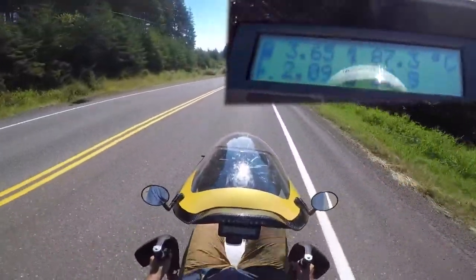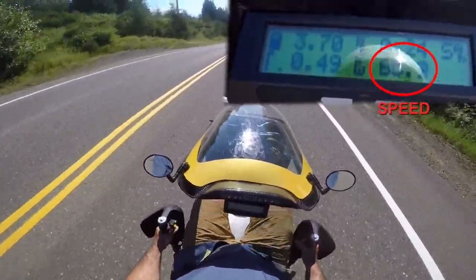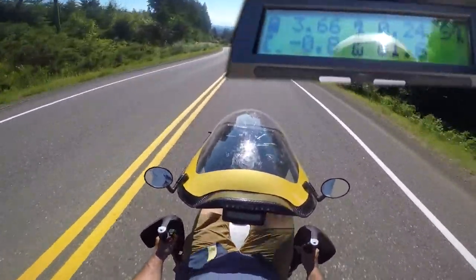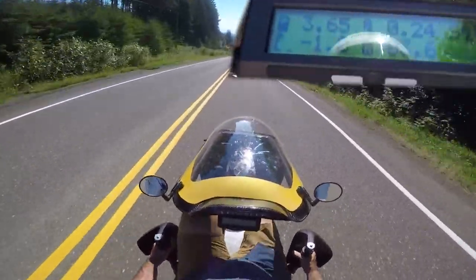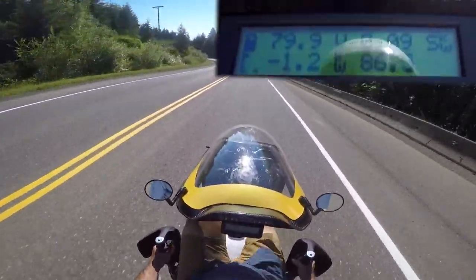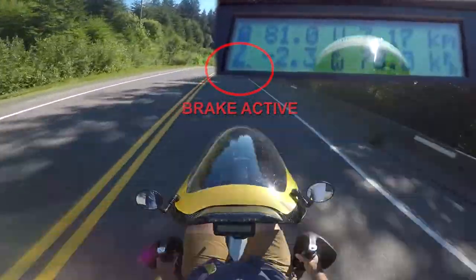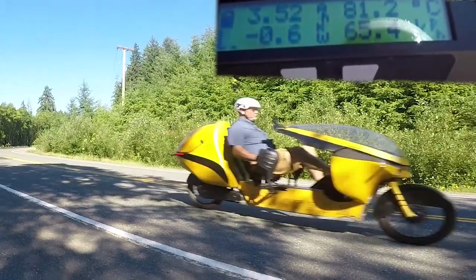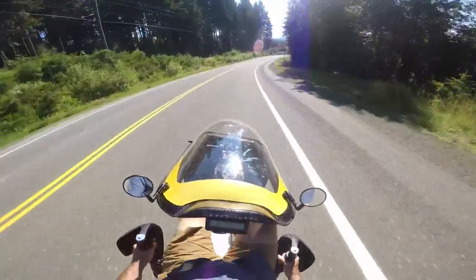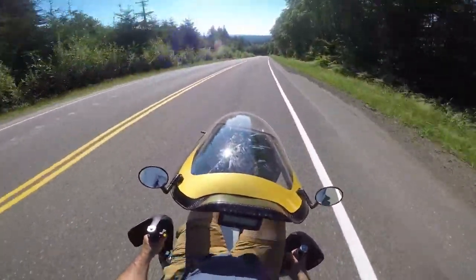Okay, we're rolling out and I've got the throttle on full so we're drawing quite a lot of power. As we come up to about 66 kilometers per hour it switches over and instead of drawing power we're now putting power back into the battery — that's the automatic regenerative braking function. In the high 80s we're actually generating quite a lot of power, about 1.4 kilowatts. As I approached a corner I applied the brake — you can see the brake symbol in the lower left-hand corner of the Cycle Analyst V3 — and at that point we produce a huge amount of power, up to 3 kilowatts at the speed I was going. And thanks to the Electrum's generator chain drive, on this whole run I've been pedaling and producing 150 watts to be stored into the battery for later use.